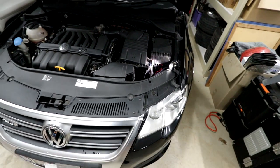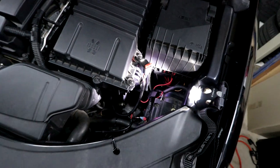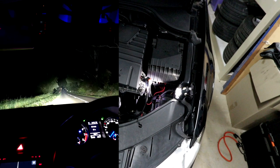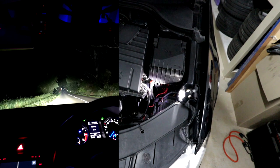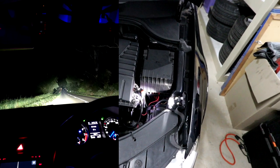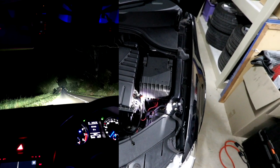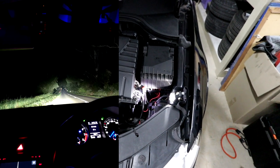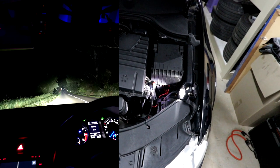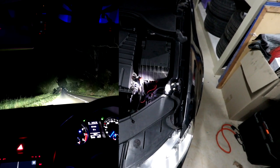There's a basic quick rundown — light bar on the R36 Passat, making a massive amount of difference to vision. I'll show comparative photos now with them off and with the light bar on so you can see the difference between the headlight globes and the high beam globes. Take note where you can't see off to the left — it's not because this light bar doesn't have side throw, it actually does have a pretty good side throw. It just drops down about 10 meters there and then continues dropping — there's a massive drop-off, and the light bar would need to be much higher to light it. But the throw on the light bar shows a massive difference and I'm super happy with this mod.